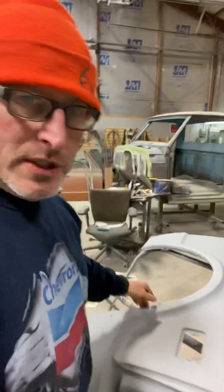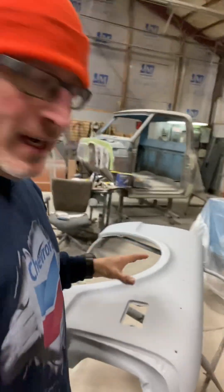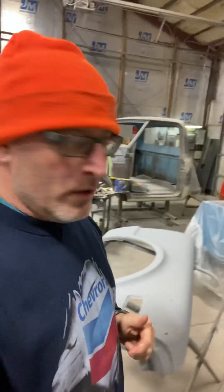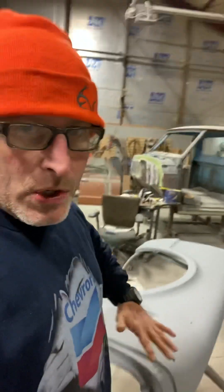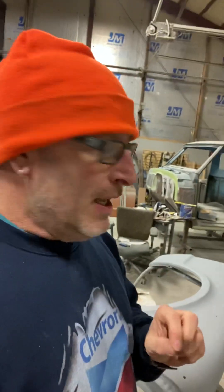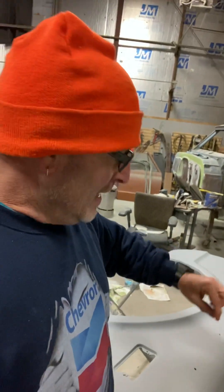What I'm going to do — we're going two-tone on this puppy. We got a blue and white going. So all of it is going to get hung up into our paint booth, what we'll call the meat locker, all cleaned out and ready to go. Everything gets painted a white sealer. That white sealer makes sure everything's uniform so you have a good, nice, uniform color. Because paint will show through if you have a dark primer, a light primer, and it's patchy. I learned that from Robinson's Auto Body — the painter over there, Randy, really helped me out on my first paint job. It's all going to go white sealer. Now this is opposite of what he told me, but I'm doing it the way I do it because I know I'm going to get a good result. Then I'm going to let that dry for the 45 minutes it needs to sit.